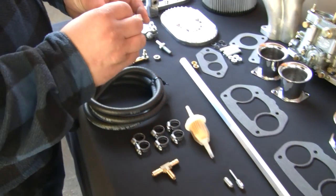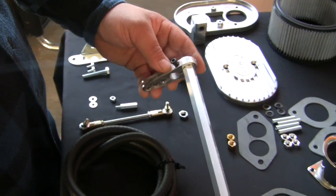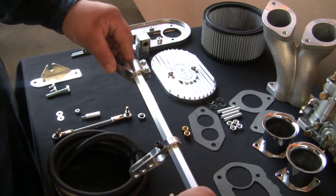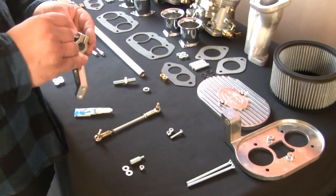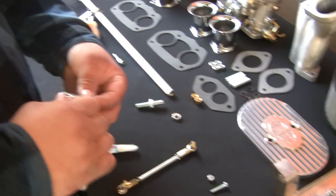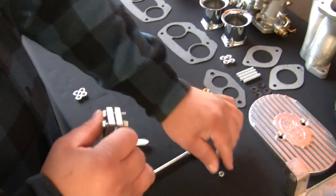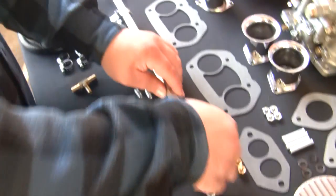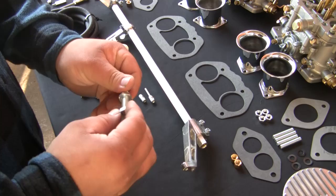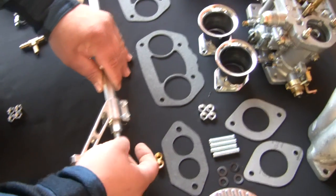Install the center pull lever with the Allen bolt loosely fitted onto the hex bar with approximately 60 degrees between the center line of the linkage compared to the center line of the pull lever. Repeat the same process on the passenger side linkage arm. Install the jam nut onto your hex bar end and install the hex bar end into your hex bar.